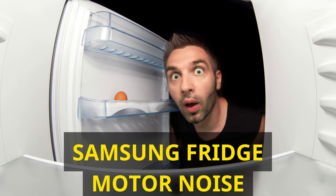Maintain the drain tray located at the bottom of your refrigerator and keep it clean. Dust and foreign objects can obstruct it, leading to water accumulation and subsequent freezing. Clean coils and vents: regularly vacuum the condenser coils at the back of the fridge to prevent dust buildup that can trap warm air. If your refrigerator has vents at the bottom, ensure they are clear of debris.